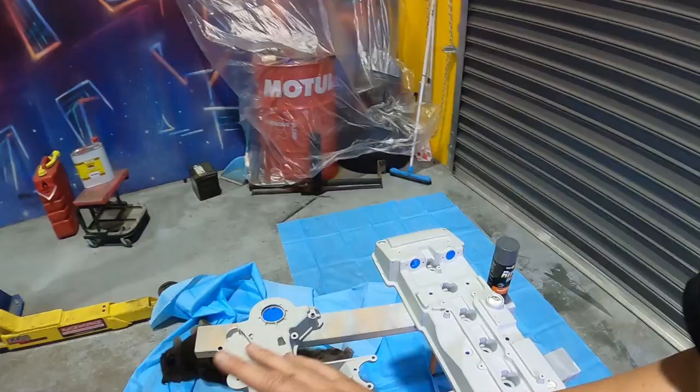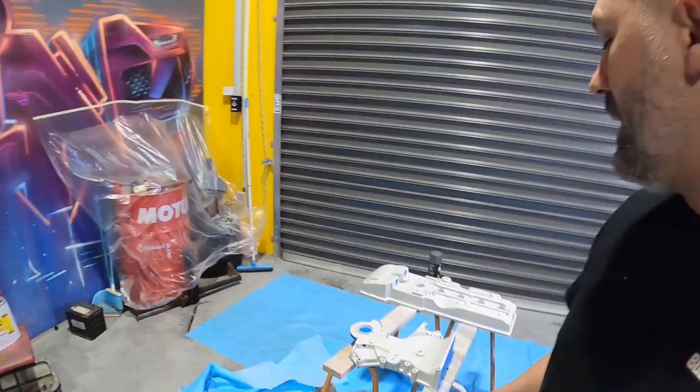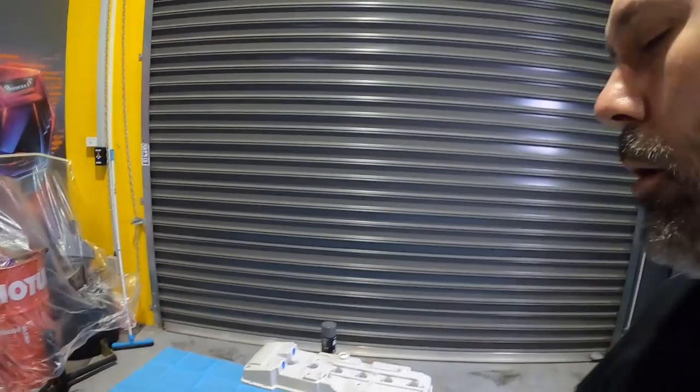A tip if you're working with metal parts is to always get them pretty warm, around 25, 30 degrees, get it nice and warm to the touch. I've already done that with these. I'll give it another hit again soon before I actually paint because I've got to clear the cat out. But keep everything warm. The reason why you want it warm is the paint will stick and start to dry and start to bond on there pretty much straight away. It's not gonna be super hot, so it just cooks immediately. You don't want that because that'll ruin the paint drying time and procedure, but you want it so it will sort of stick to it and sort of melt on or bake on, for lack of a better term, but not too hot, around about 25, 30 degrees approximately.